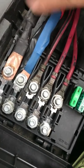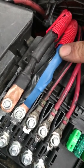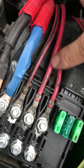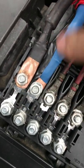First I thought this was the issue, but come to find out it was the second one that was overheated. About two days ago I changed the first one — I did a pretty amateur job on it. Here is the cable that goes into the alternator; the alternator comes in here, charges the battery, gives everything else power. This one leads to the cabin under the steering wheel, which powers all the fuses and relays. These metal pieces are all fuses, which I did not know — my fuses were not blowing.